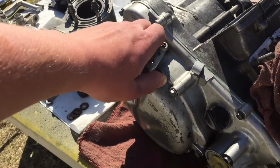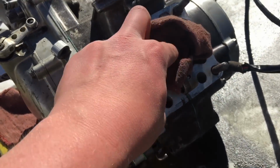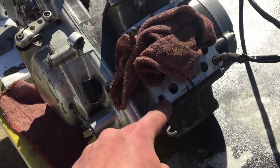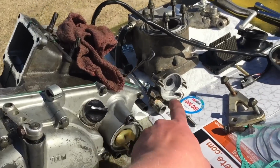It feels really good. Then I also need to put in a new stud, because this one totally got destroyed, if you guys remember when that nut was stuck on it. But I have a new one, so we're going to be putting that on. So what I'm just going to do quickly first is put on the water pump cover.